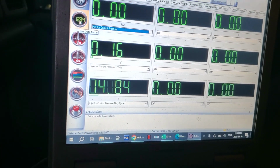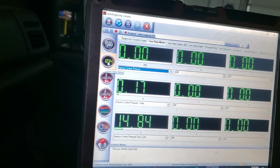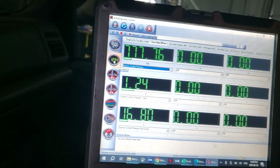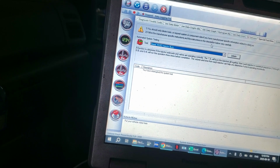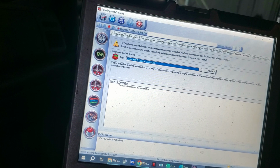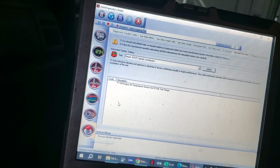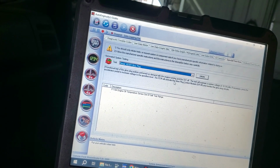So we're glow plugging, right? We're going to get as much glow plug as we can. Sometimes if it's not starting well, I'll glow plug it like 2-3 times right away. So that's not too bad, right? You can hear it's running rough. So let's do a quick cylinder contribution. Okay, so it's not warm enough. We need to have more oil temperature. So let's run the glow plug test. But it is definitely running rough.